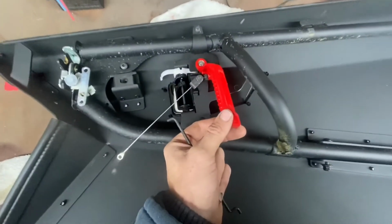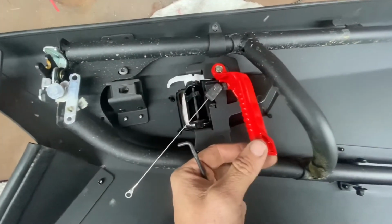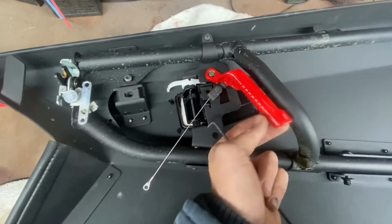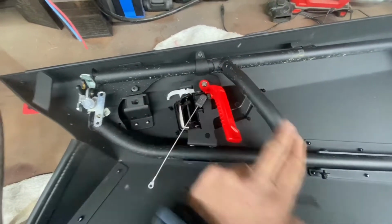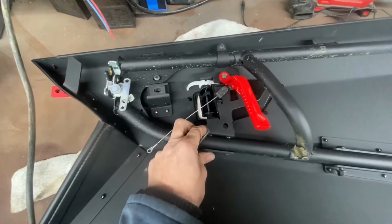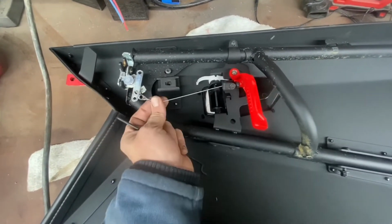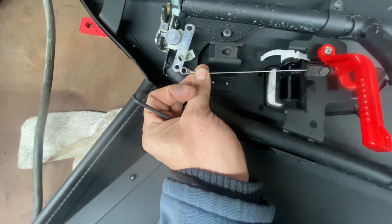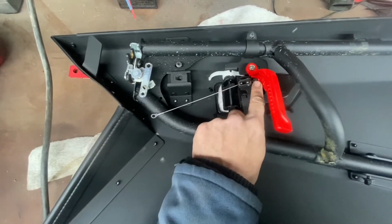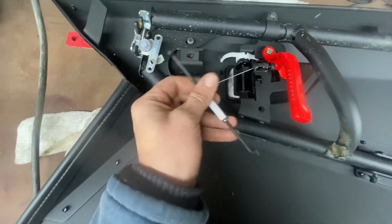All right, so when you get your inner lever mounted with your little silver bolt, it's got a lock nut on it. You want it snug, but where it moves easy. You don't want it too tight or it'll hang up. Set that in there, set the frame back on, run your bolts in here, run your bolt up here. They're in the kit, they're little 5mm thread bolts. Small, don't over torque them, you'll break them off. This little cable will rivet into that bottom hole. You'll screw this out, readjust it to wherever it's nice, and then run your little lock nut down, snug it up.